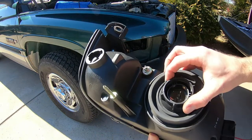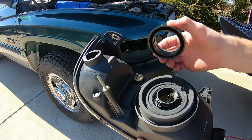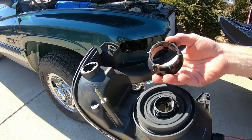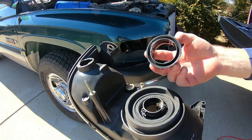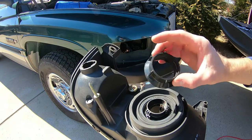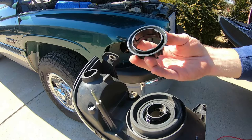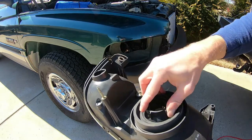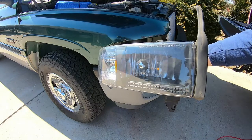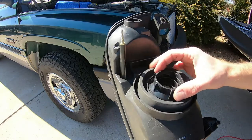On at least these aftermarket headlights, and probably the OEM Dodge lights, they have a retaining ring for the 9004 series bulb. When I was piddling around with that, some of the little retaining teeth broke out, and I got tired of trying to find an exact replacement for these aftermarket headlights. So we're just going to pull the lenses off and do a proper retrofit with some HIDs.